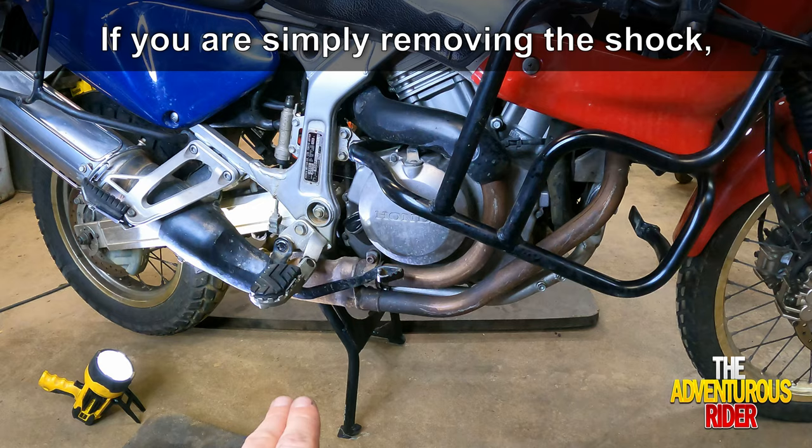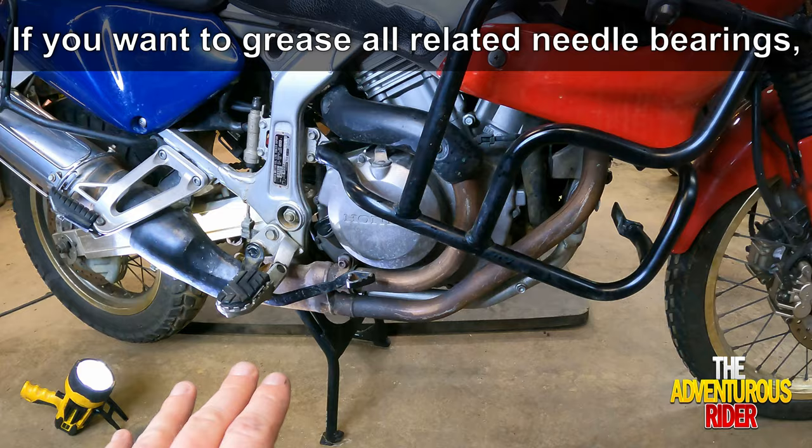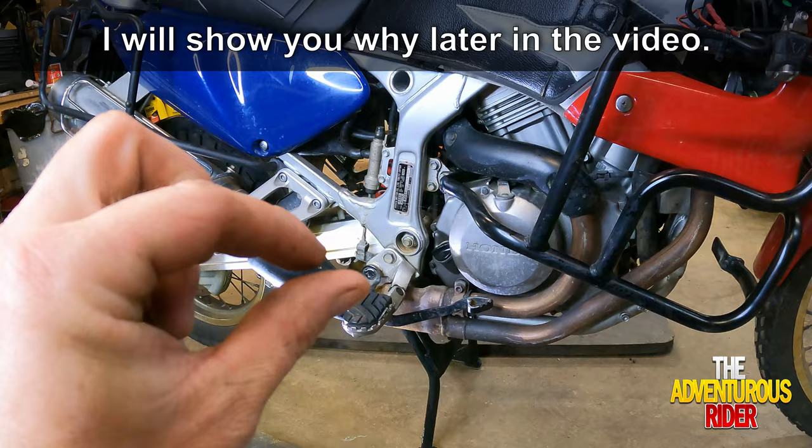Like all my other how-to's, I'm going to have all the parts that you need and the tools down in the description, and I'm also going to pop them up right up here. So the first thing you need to do — kind of like you see on mine — I've got it sitting on the center stand. You may also be able to use a motorcycle jack to support it so the rear tire is up off the ground, which helps decompress the shock and makes this process a lot easier.